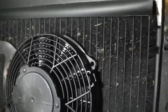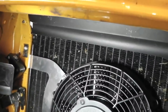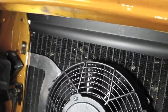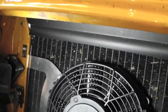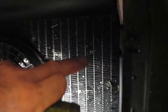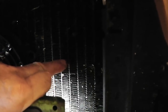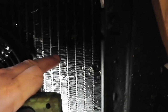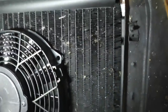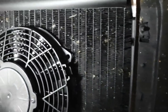So I think I'm pretty confident there, but I may just line it up just in case so the bolt head lines exactly up with the cooling fins. So if it did push back, it's going to push into the cooling fins, not the core. And the core, when I talk about the core, I mean these vertical cooling cores of the rad. And there's the fins in the middle. Now, they're not carrying water, the fins. They're just to create surface area, aluminium. So it wouldn't really matter if they got hit. Okay, so that's how we're going to do it.